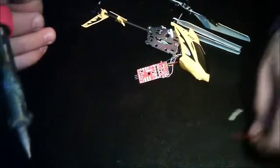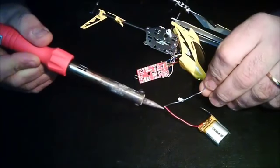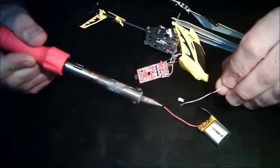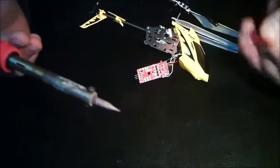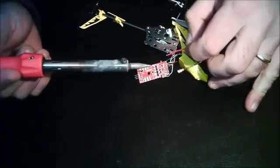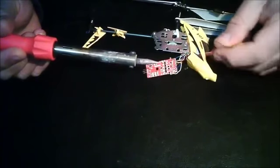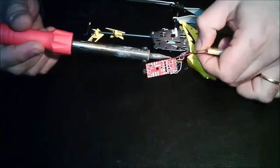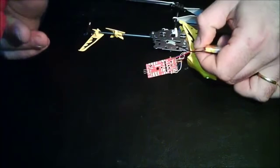Okay? And now let's go. It's a good idea also to tin your wire, so let's put a little bit of solder on the wire, because as soon as you apply some heat with this solder on that one, it should melt and you have an immediate connection. So let's see if I can show you that. So there you go. Very gently. There you go. This is it.